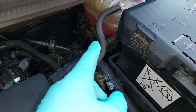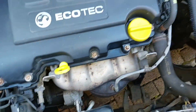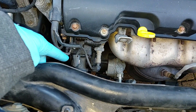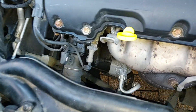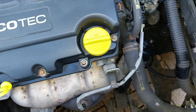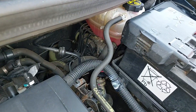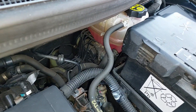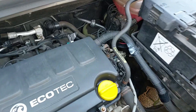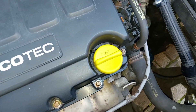Only two and a half liters came out in total. If you look at this engine, there's a high hose here and a high hose here, so a lot of the fluid stays in the engine and it's difficult to get out. I think the only thing I can do is run the engine now and let that two and a half liters circulate, then empty it again and fill it back up. That's the best I can do - at least there'll be mostly new fluid in there.